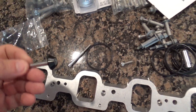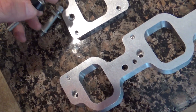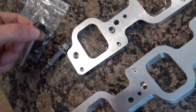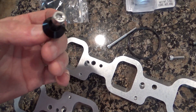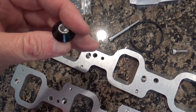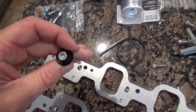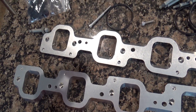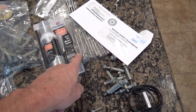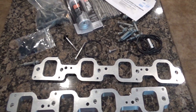I had to order these bolts because I didn't have any that were exactly the right size — you need them 65 millimeter. I bought these from East Coast Bolts on eBay for like $10. And I bought these washer-type bolts because the hole in that manifold is pretty big. The plan is to run those really long bolts down into the hole and screw them in, center the manifold up on them, then unscrew them and put the right bolts in. Hopefully it'll draw it straight down and everything will line up pretty good.